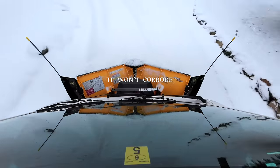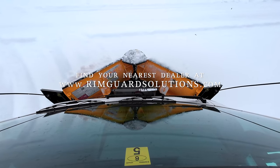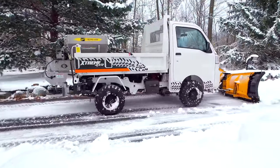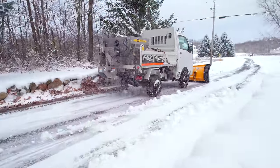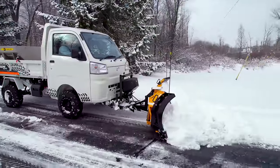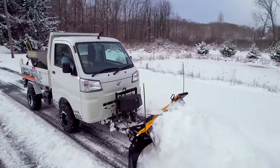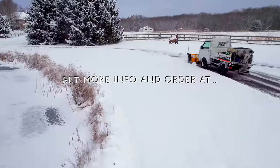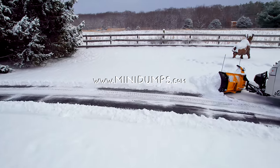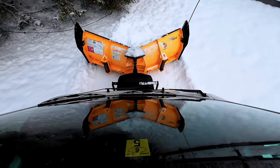Working great. I found myself mainly in first and second gear, so not a lot of shifting — first, second, and then reverse. It does come with a little mount for the plow controller, and I haven't mounted that yet because I wanted to see how I would use all of this — the steering wheel, the manual transmission, and the plow control — and get a feel for that before I screw in or adhere the mount. I think I'm going to mount it on the right side, so I can use my right hand to control raise and lower the plow, change the angle, scoop it, V it, whatever I want to do, and then dedicate my left hand to the transmission and steering wheel.